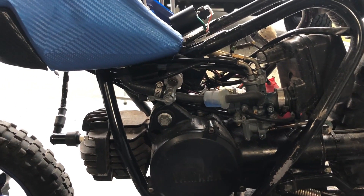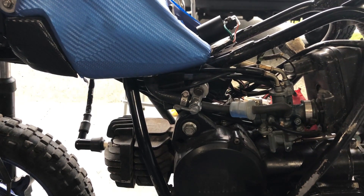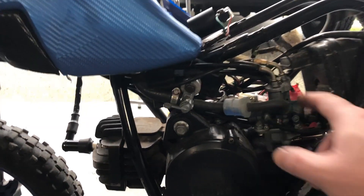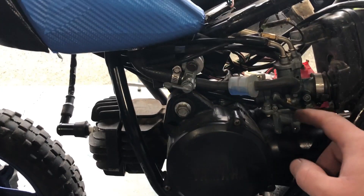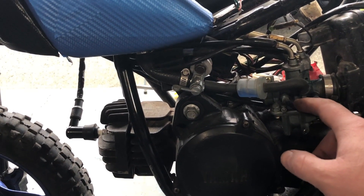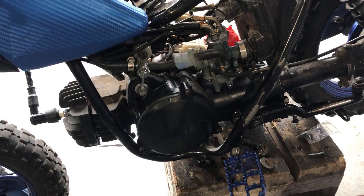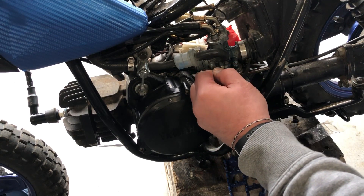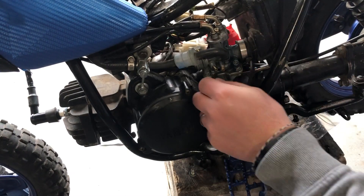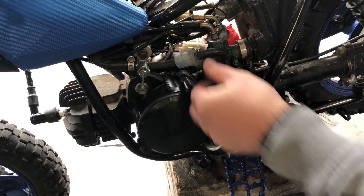Because I'm going to be mixing my own fuel from now on, I need to drain the gas tank — you don't want to have a lean fuel-oil mixture. I'm gonna drain the whole tank by removing this hose here from the carburetor. I'll also go ahead and remove the oil pump hose. We're gonna put this little cap that comes with the kit — you don't want air getting in there — so you pull your oil line off and then slide this little black cover over top so it doesn't suck any oil, water, or air in.